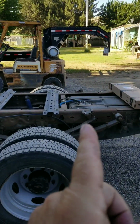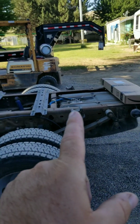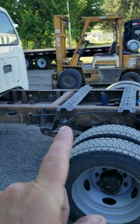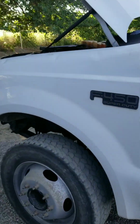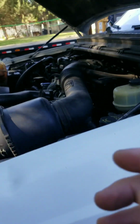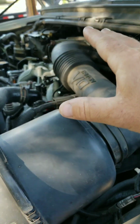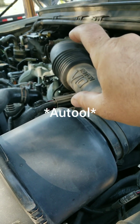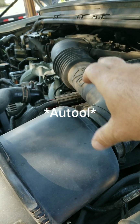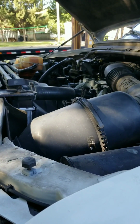So we keep going back to fuel pressure. We clean the tank out and everything, and we keep driving it, and fuel pressure seems to be staying good. I take the injectors out a second time and test them. Everything looks good, and I don't want to replace injectors if they look good. So we put them on this little Altel thing I've got on my channel that shows spray pattern, pressure, and volume that they're pumping out. Everything's pretty good.